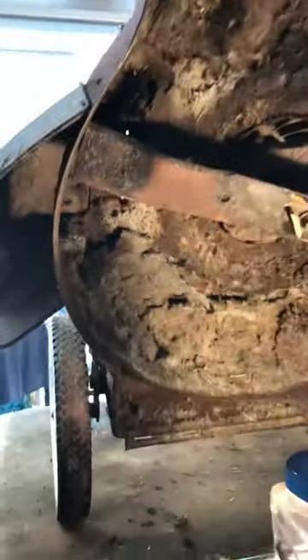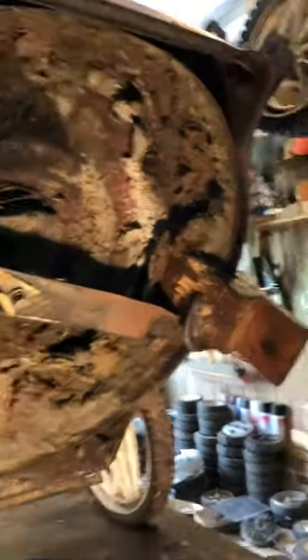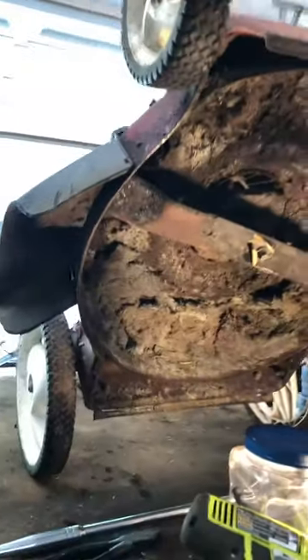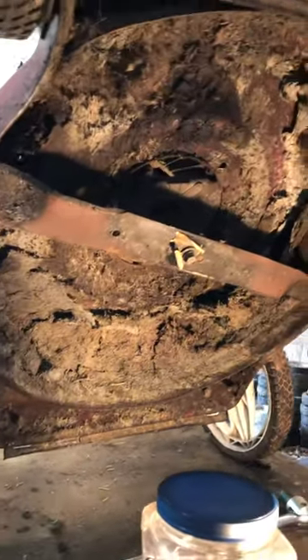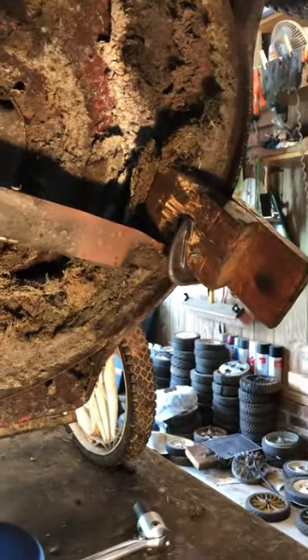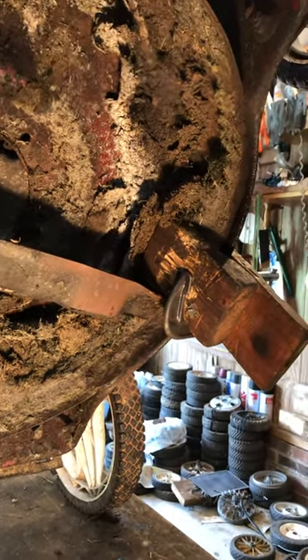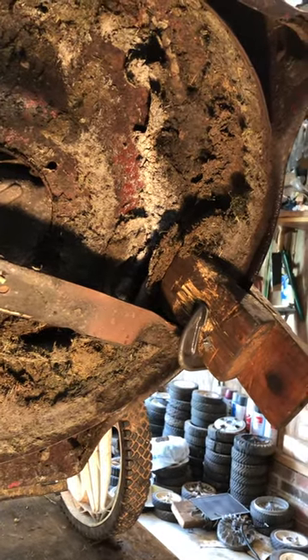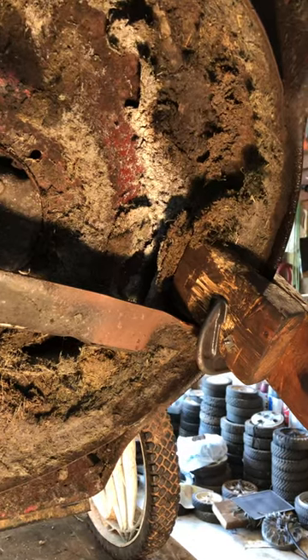Here's what that looks like. I've got a block over there because I'm getting ready to take the blade off. This is a safe way to work on a lawnmower blade — put it on a surface, I've got mine on the table tilted back. Then put a c-clamp with a block of 2x4 on the inside and a half-inch piece of wood on the outside, clamp that down so you don't damage the paint on the outside of the mower.